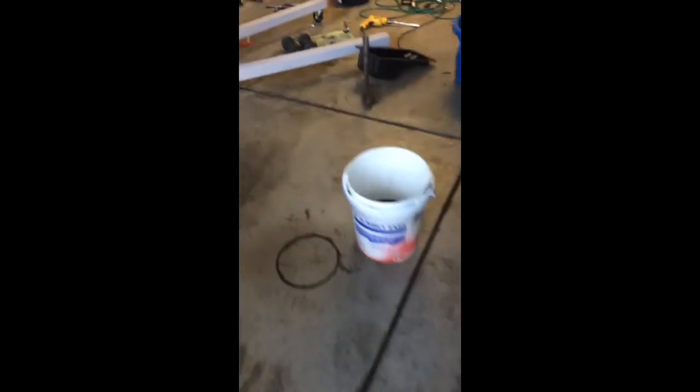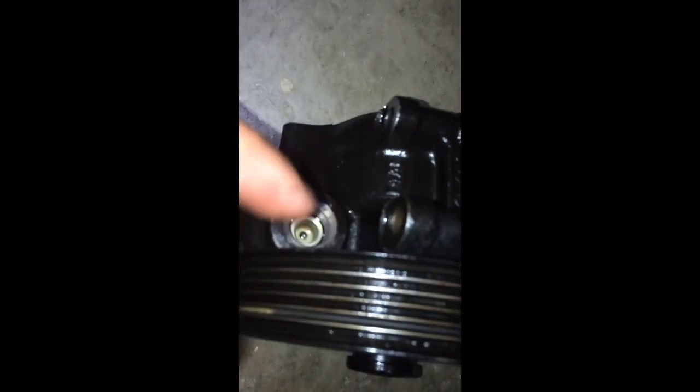That's 3 bolts. Actually, no, that's 4 bolts. AC is, or sorry, excuse me, that is AC. Power steering, 4 bolts as well. There's 1 bolt behind the pressure line on the AC. It's your top left line. And when you're looking at the pump, and I don't know where I put it. Basically this line right here, there's a pressure line that goes in right here, and there's a bolt that comes out here, and the line comes and elbows out over top of it.